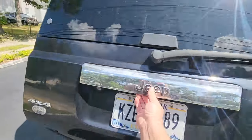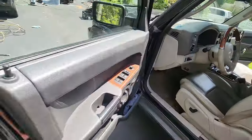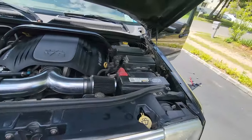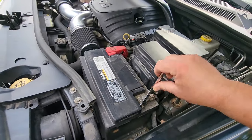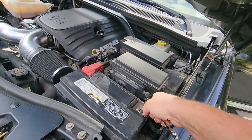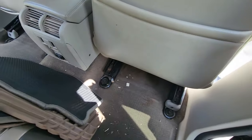Open up the rear tailgate — it's electronically openable. Pop the hood, then disconnect the battery. Why? Because we're going to be unbolting the dashboard that has airbags in it. We also have to take out the interior that has airbag modules, and I don't want to be unplugging things and have the airbag pop in my face. Safety first.